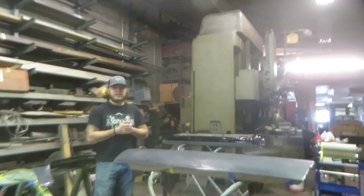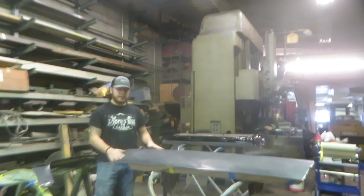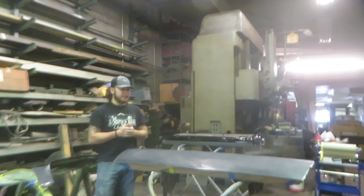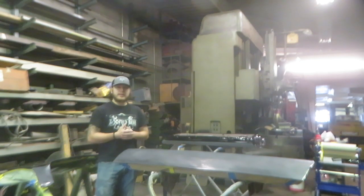We're either doing 6 coats or 9 coats, just depending on how shiny and reflective it is on the next coat. But when we get to that last coat, we'll wet sand it with 2,000, 3,000, and then we'll buff it. And then it will be perfect and ready to be put in boxes until we get the rest of the car painted.